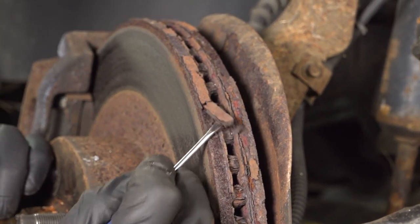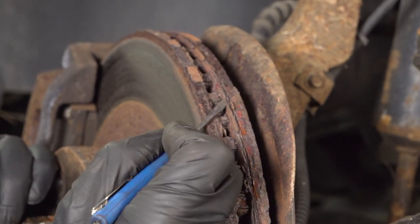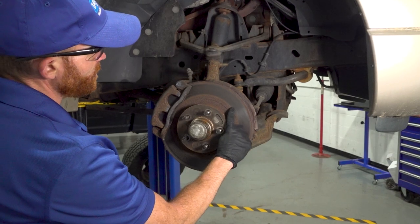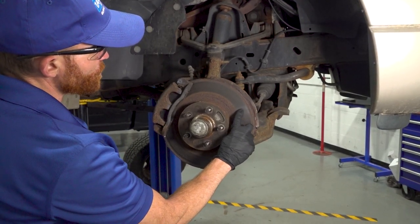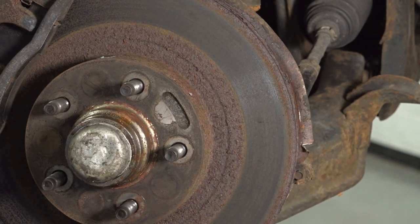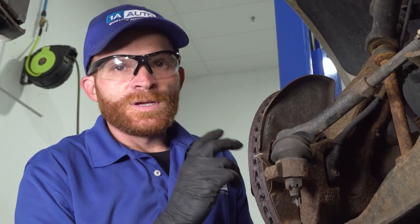Since we're talking about things hitting, it's common for there to be rot buildup on your rotor. When that happens, it could potentially hit up against something and cause noise. Also talking about the rotor, I want to mention the braking surface — you'll have an outer braking surface and the same on the other side. It's common to see a lot of rust on the braking surface, especially if your vehicle has been sitting for a while. Any rust or debris buildup can cause noise and even brake pulsation.